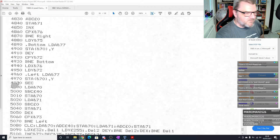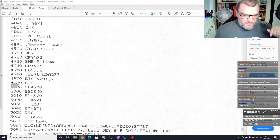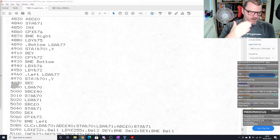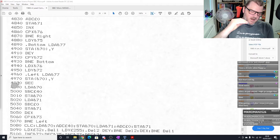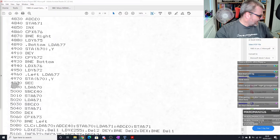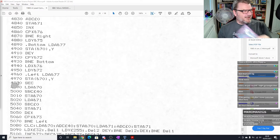But more importantly, I have got the BBC that my dad had to convert the program for the NCB. It came with the Z80 second coprocessor. It came with a 6502 second coprocessor. It came with CP/M, Fortran, COBOL. It had a dual double-sided switchable 5.25-inch drives, so it had the stacked drives. And it had the original sideways RAM board on it. So when you open it up, you've got the motherboard at the bottom, and then sitting right smack on top of it is another motherboard, which is the sideways RAM board. It's not the size of this little fella. It actually covers 3/4 of the board.